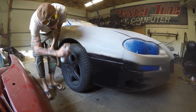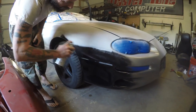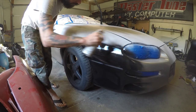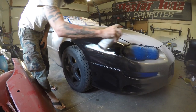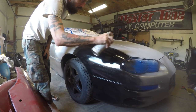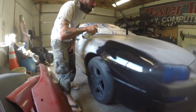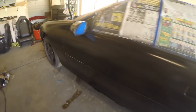See how it all stays wet. I got a couple of runs there, so we know we need to move a little faster with the hand. If you have any streaks, go right back over them while it's still wet. If you do it nice and smooth all over, this is what you end up with — nice satin black, no runs or rough spots.